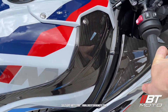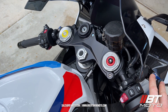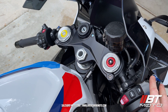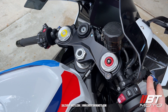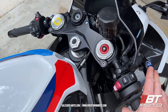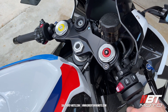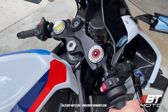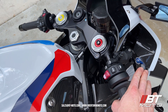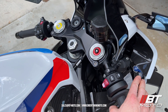The way I break in a motorcycle is I bring the bike up to operating temp. First I buy it and tell the dealer don't ride it — they do the PDI, which is probably about two miles, just to make sure the bike doesn't fall apart. Then I let it idle for 15 minutes, just sitting there, waiting for it to get to operating temp.